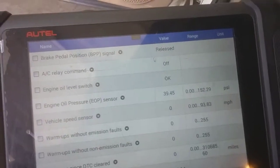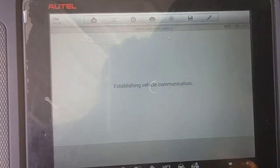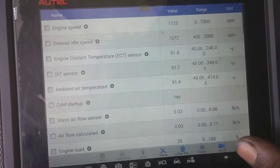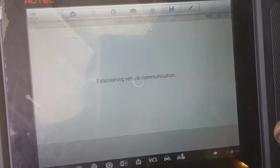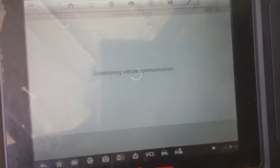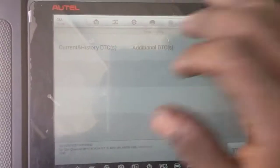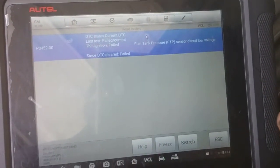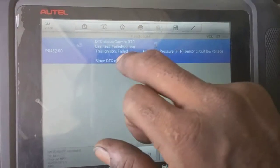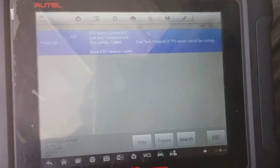We're gonna address the next P0 code, which is that Evap sensor. But before I do, let's make sure that the car is satisfied with the repair. So we should only have one code now. What the heck? Did I do that on purpose or by mistake? Oh, that's right, because I would have live data. Okay, cool. So we should only have the Evap code or the pressure sensor come back up. Awesome. So the other issue's fixed, and we're going to work on tackling this P0452 code. So, all right, it's on to the next video.